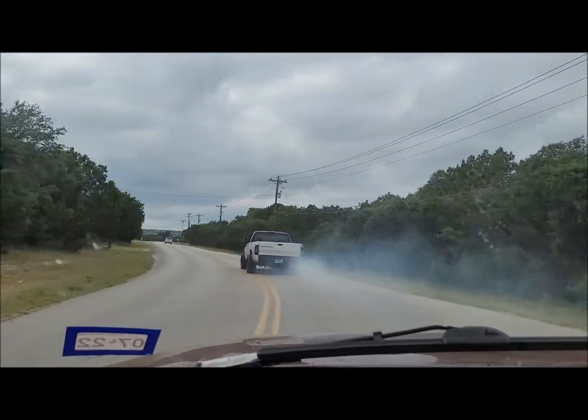Looks like it's coming from that plug for sure. That bolt isn't even tight. Can't tell if it's even in the turbo drain. Can't win them all. Going to go find a Lone Star somewhere and hit the road. That turbo is smoked — it's just pissing oil out the downpipe, and the downpipe's not connected to the exhaust. So there's that. Attempting to drive it about four miles back to his brother's house to see how it goes.